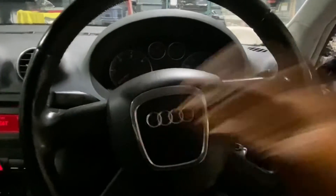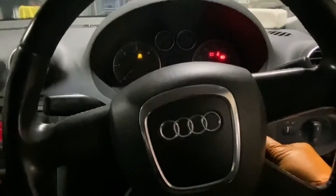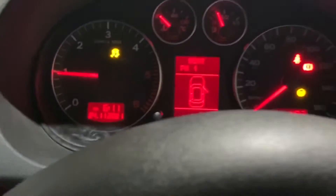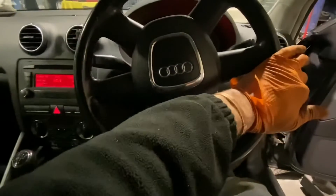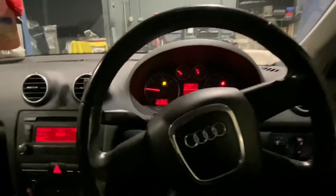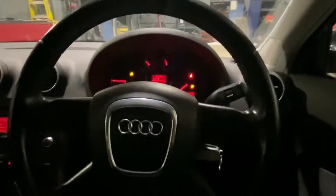I cycled the key with the airbag off just to confirm it turned. We may have an airbag light on but it should go off. Up and running — I can see an ESP fault here. I'm not sure if there's an airbag warning as well. If you cycle the steering wheel all the way to one side, then all the way back, and all the way back again, or start moving, in theory the ESP lights should go off.